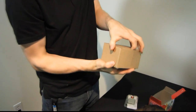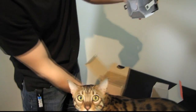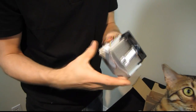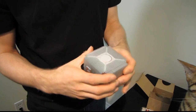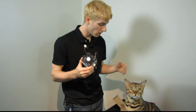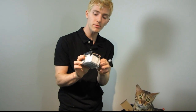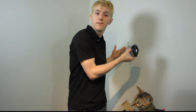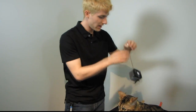Let's have a look at the heatsink — I think you'll be quite surprised. It looks just like a heatsink for any other AMD socket from the last six years, going all the way back to socket 754, with the two clips on either side, some fins, and a copper slug. That means you can actually use your old heatsink solution as long as it's rated for a TDP up to 100 watts. These do have a graphics chip on them, so they kick out a little more heat than a standalone CPU, which is why the higher TDP — even though overall system power consumption will still be very low. The heatsink has a PWM fan, so that's a four-pin fan.